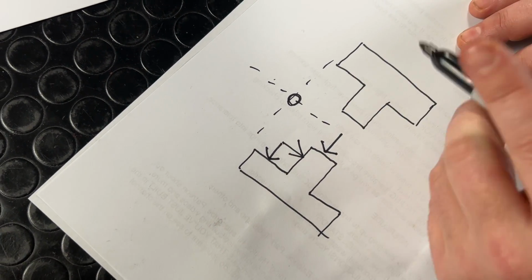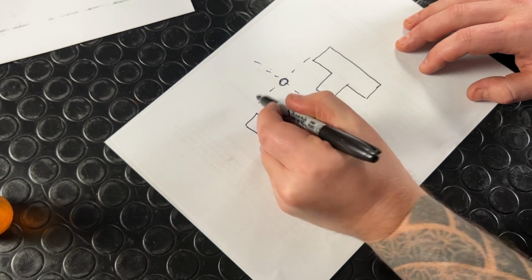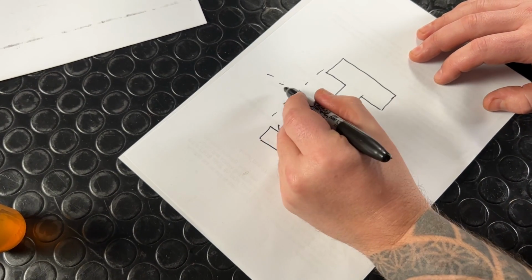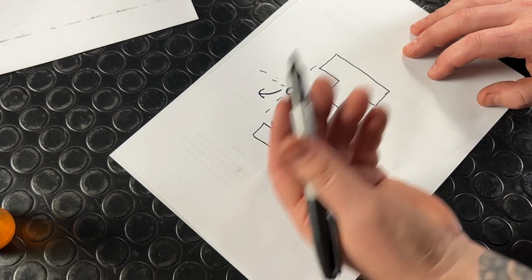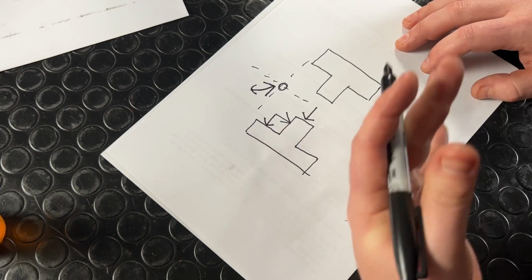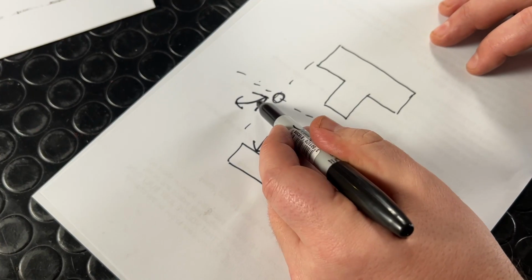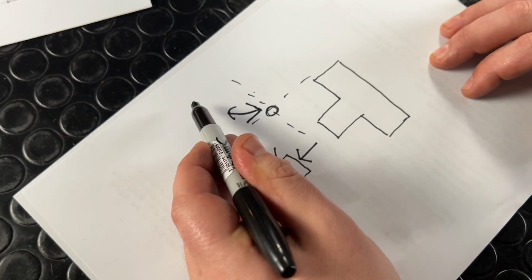It takes a little bit of getting used to and a little bit of imagination, but let's just say that you saw, in visualizing this matrix, that your rim was both up and to the left. Well, that means that it needs to go down and to the right. In that case, you know the rim needs to come down radially. You could reduce some tension from the left-hand side of the rim to allow it to swing in.